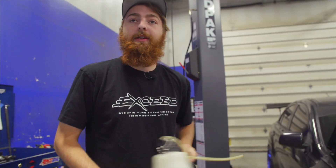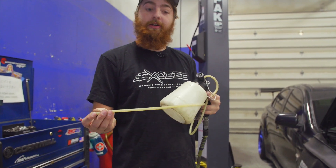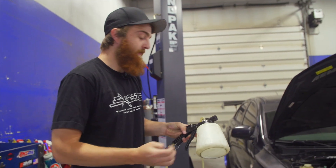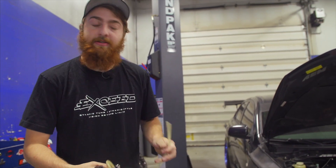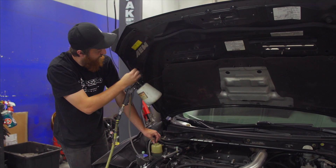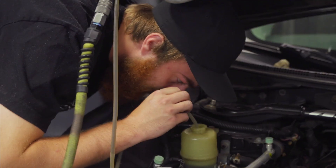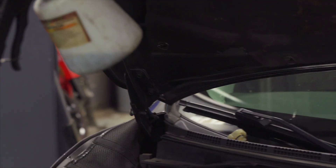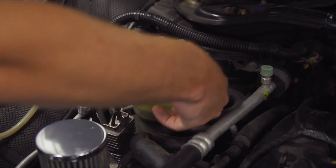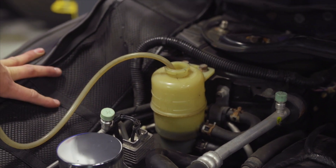The first thing we're going to do is extract all the power steering fluid out of the reservoir. I like to do this with one of these brake fluid bleeders — it's a cheap one but I use it for pretty much anything that needs fluid removed. It's super easy and it doesn't make a mess. You're only going to be able to suck fluid out until the bottom of the fitting, which is okay because all we need to do is get the hose off and unbolt it, then swing the whole thing out of the way to avoid making a mess.